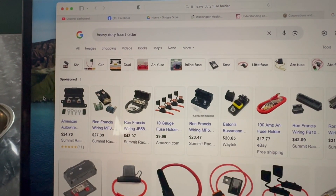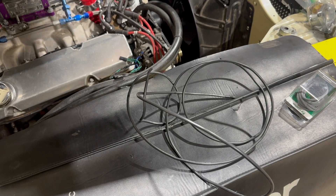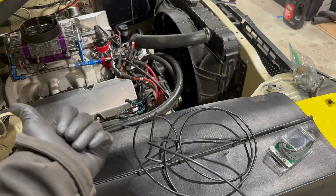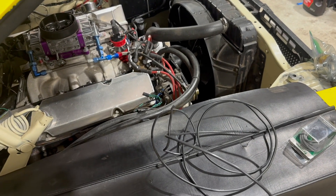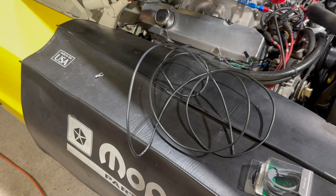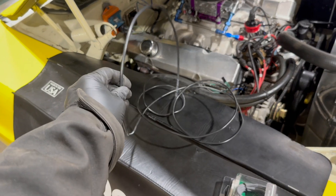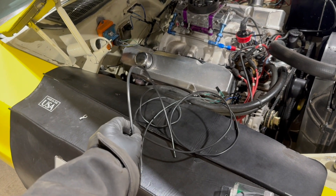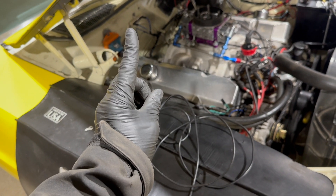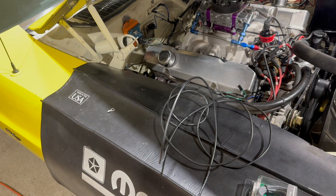With our factory units, something like a 40-amp fuse is probably fine. I use 10-gauge wire because it's similar in size to the factory charge wire. The idea is the load is split between this and the factory circuit — the factory circuit will be just fine at 15 to 20 amps maximum, and so will this wire. It's actually rated for 30 amps all by itself. We could use a larger wire, say 6 or 8-gauge, but with that wire in place, the vast majority of the flow is going to go through it, and that brings us back to the downside I mentioned. When we add this, we're not going to get much of a reading on our ammeter anymore. It may show some movement, but in general we're not going to get as accurate of a read, and with a bigger wire that will definitely be exacerbated.